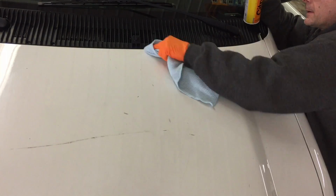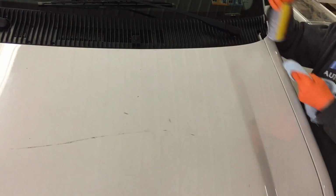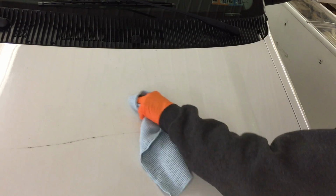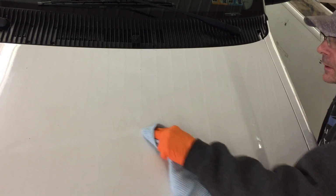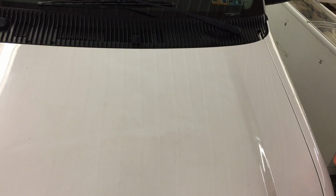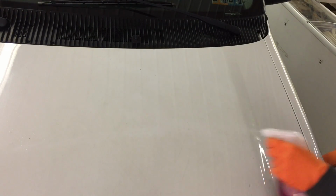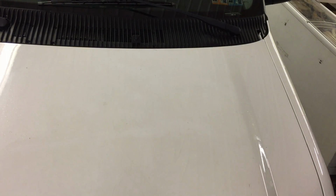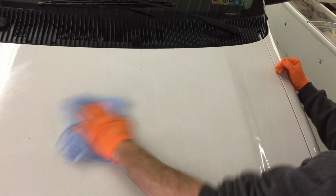So as I go around the van and get some of these spots, let's talk about what it can remove, what it can do for you. When it comes to painted surfaces, any kind of transfer whatsoever, but more importantly, what I get asked a lot about is overspray. When I talk about overspray, that can mean just about anything really. You park close to a body shop or close to the ventilation system of a body shop. A house or a building is being painted. A bridge or a parking garage is being sealed and painted. Also, overspray from being parked too close to the road when it's being blacktopped. A driveway being resealed. The roadways being repainted, their lines being repainted.